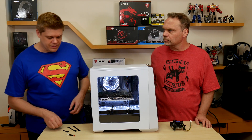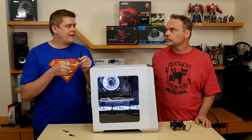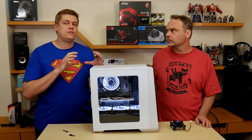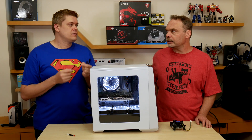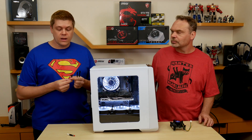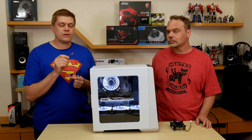Mounting it wasn't too hard either — it ships with both AMD and Intel brackets. You do have to actually screw it in on the mounting plate, and then you need access to the back of the CPU where you use a wrench — which is also included — to attach it onto your motherboard. It was a pretty unique looking mounting device. Good thing is that Johnsbo throws in some thermal compound just in case you didn't have any lying around.